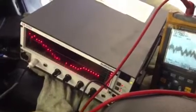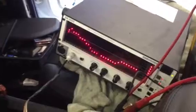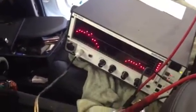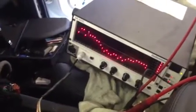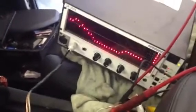We can send this signal straight into an amp, but we're going into a bit 10 processor. The bit 10 actually allows us to fix this EQ — this stock EQ curve from the deck. What's important here is that the EQ curve isn't done in the Bose amp, like a lot of people think. It's actually done out of the output from the factory radio, so we can fix that with a bit 10 processor. We'll show that a little bit later.